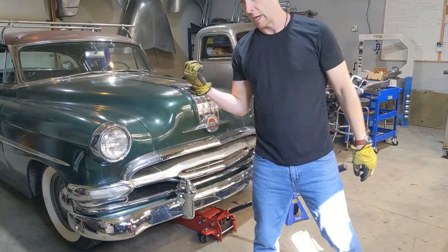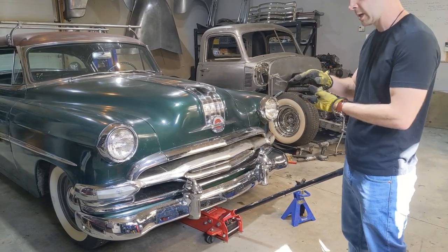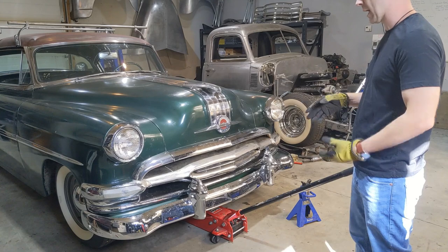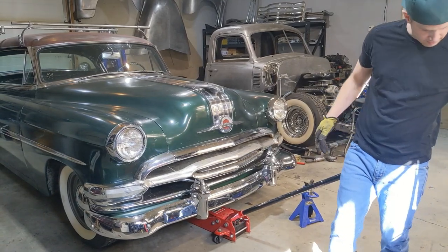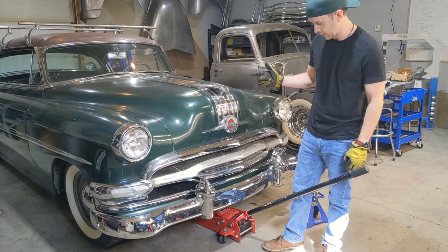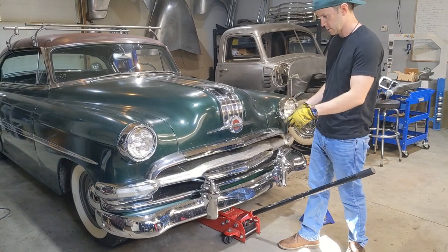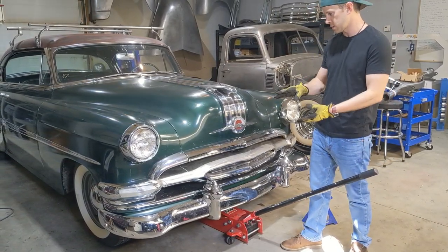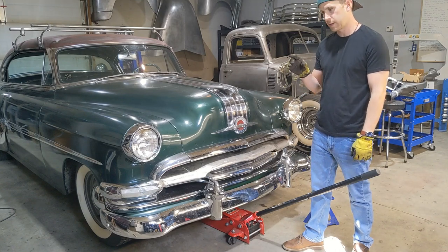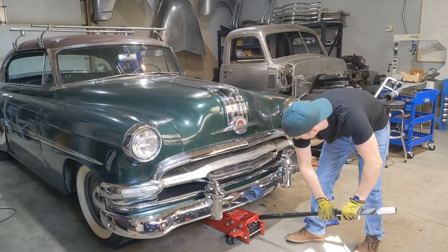Well, after I dropped it, the lowering spacers that I put in dropped the control arm lower bracket way too close to the ground. Very unsafe, so I'm undoing what I had originally done. I'm actually gonna cut the coils. So previously, drilling out all the rivets actually saved me a lot of time, because now if I want to remove the coils and change out the shocks, all that good stuff, all I have to do is undo those 6 bolts. So that's what I'm gonna do right now. I'm gonna take out those spacers and cut down the coil, drop it, and I'm gonna replace all those spacers with, again, 3/8 grade 8 fine thread hardware. So that's what I'm doing right now.